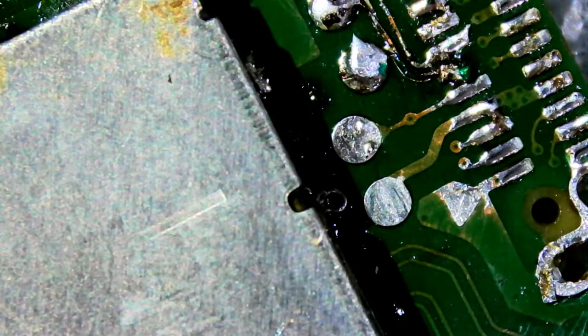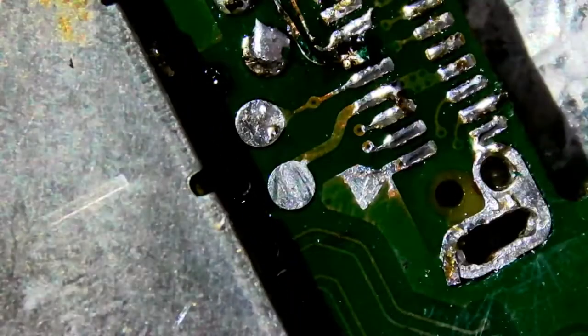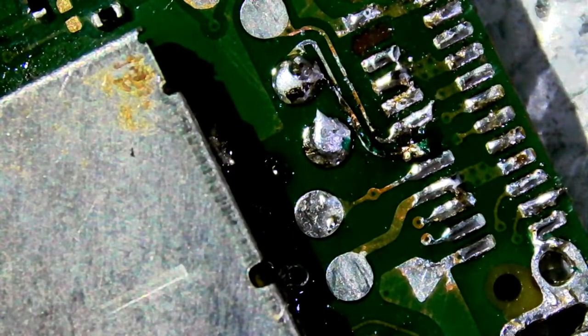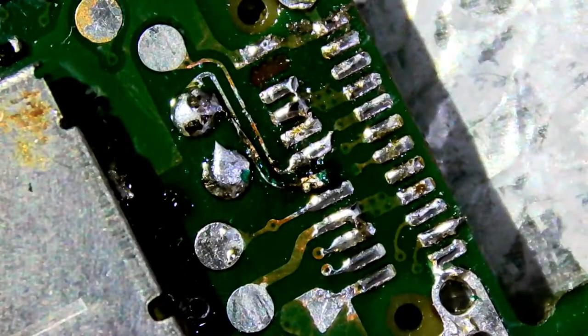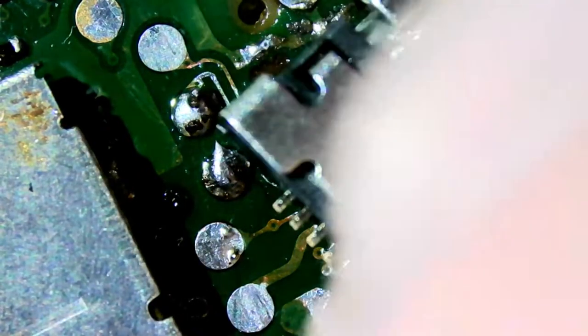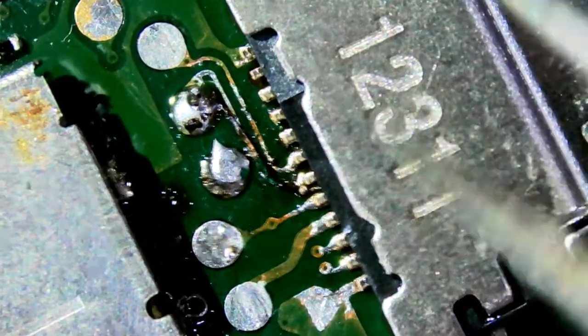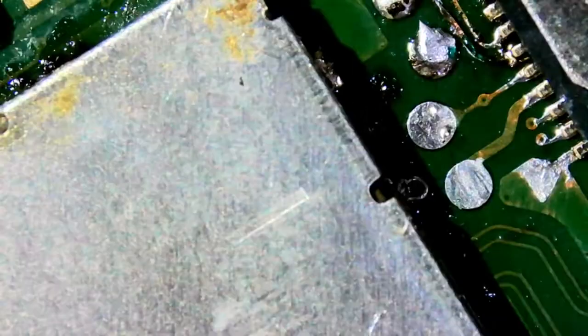These things are seriously small. Really small. Amazingly small. That looks pretty good, I think. I tried to get the port lined up on it just to see if it does look okay. Now all the ports I did buy were off a regular Switch, so they do still fit, however they're a bit longer and you need to modify the casing of the Switch Lite for them to fit. But it looks like all the pins line up, which is a good start.